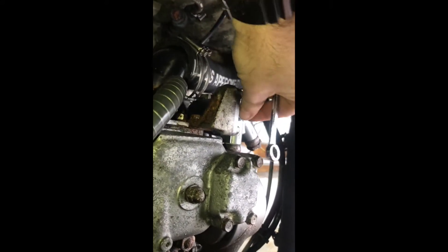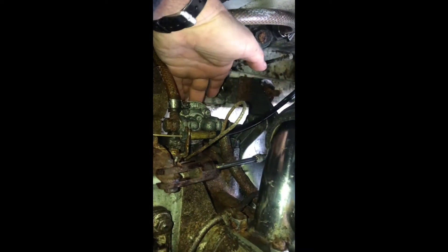I'm going to bleed the engine, get it started, and get some antifreeze through it. The first bleed screw is here, so I'll take a little turn on that. Then on the fuel pump down here underneath there's a little lever that I can push, and then keep watching this until some diesel flows out. I'll do that a bit more — keep pumping. Not sure how long this will take.